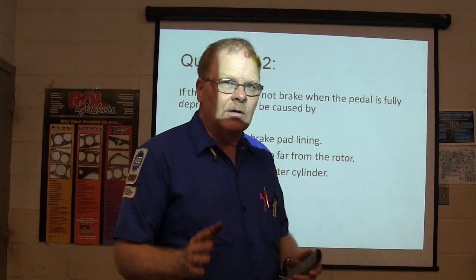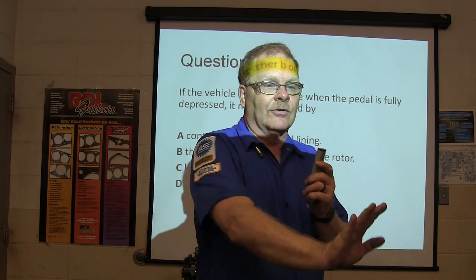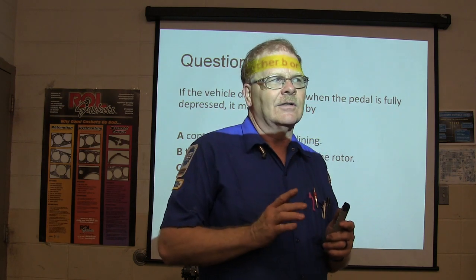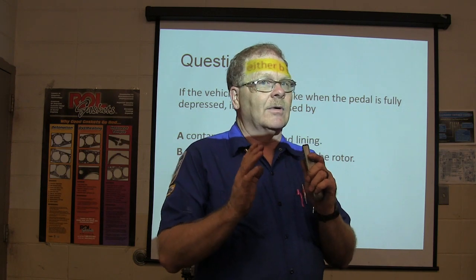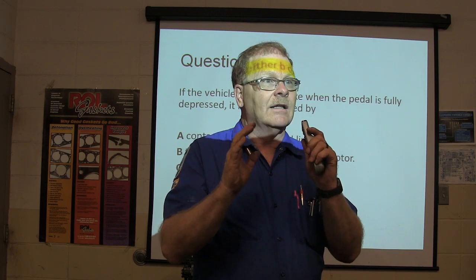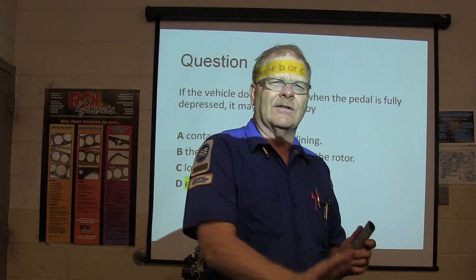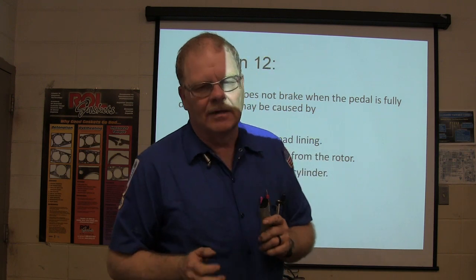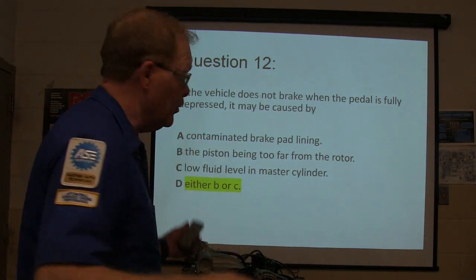You guys know that when you're putting the rear brakes back on, if you don't have those brake shoes adjusted where they're real close to the drum, you're going to have a pedal that goes down and then catches higher. Right? Even if all the air is out of there, it'll fool you into thinking sometimes that there's air in the brake. So when you put the brake shoes on the rear, you better adjust those brake shoes where they're really close to the drum, Mr. Honda man. Because whenever you put them shoes on there and put it back on, you say, oh man, I did a good job of that. Why doesn't the pedal feel good? You got to make sure you don't adjust them so far that it's going to heat the drums up. But you want them close enough so when they max the brake, it's going to touch that drum right away. That is really, really, really important.